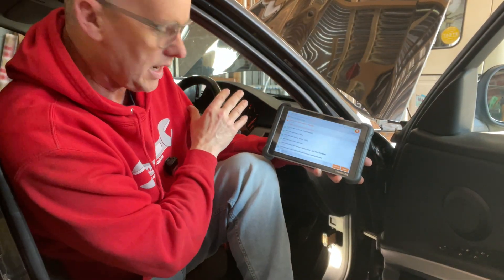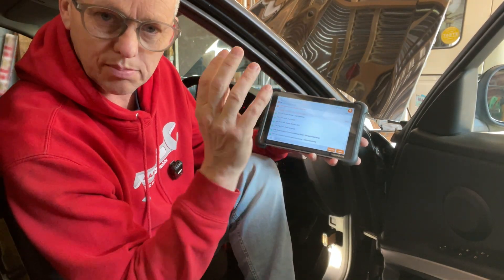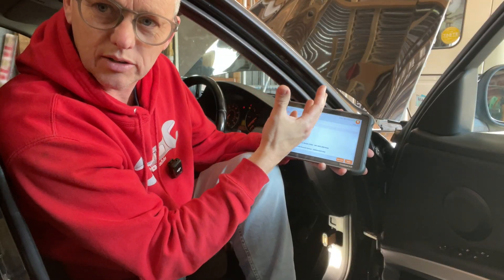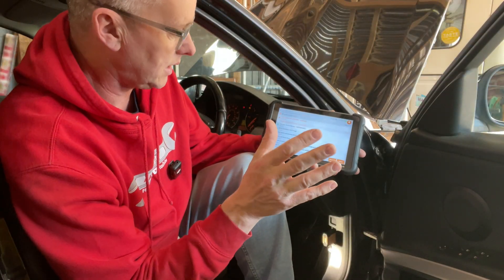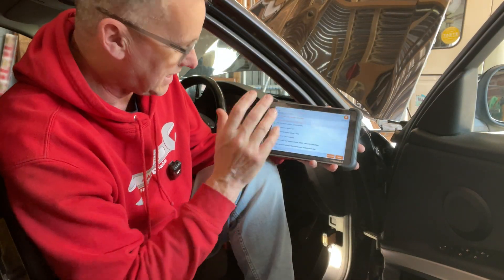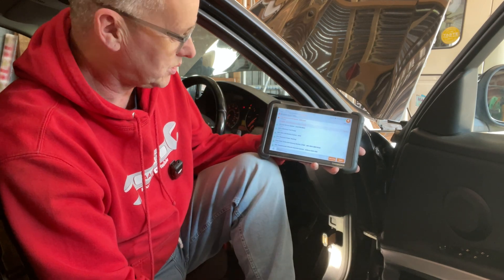AUC sensor changed, everything's working again. So when there are smelly fumes from a vehicle in front, or if there are contaminants in the air, it'll pick that up and put the recirculation on the heater automatically. And it gets rid of that fault code — so that's one that we've sorted.